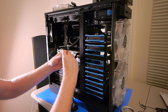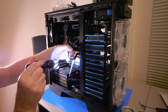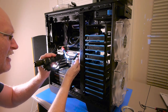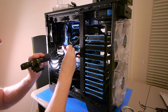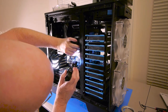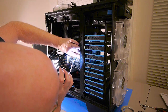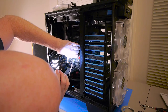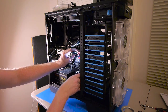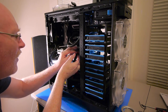Now the other 6-pin connector plugs in as well as the 2-pin connector, but you want to make sure you get that in the correct way. And the way you know it's the correct way is there's 2 little ears on the connector, here and here. And when you look in the housing, there's a little slot between things, so that connector goes in that way. It can't go in that way. So it has to go in that way. And we'll throw in the 6-pin beside it.